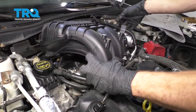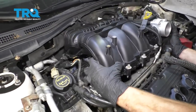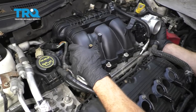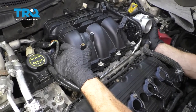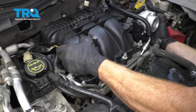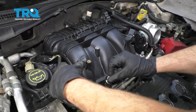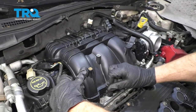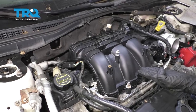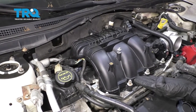Carefully slide the intake in and underneath our fuel line — we want to be very careful not to damage that. Bring this down and line up all of the bolt holes as we come down. Start in all of the bolts before we snug any of them up. Once you have all your bolts started, continue on snugging these up and then torquing them to manufacturer specifications. When we tighten this, we need to go in a specific order.